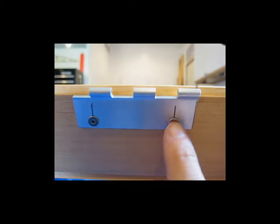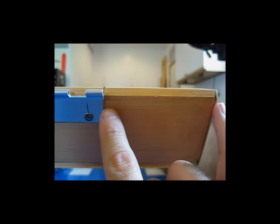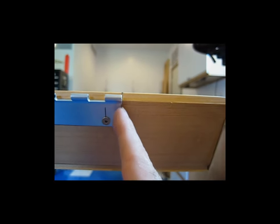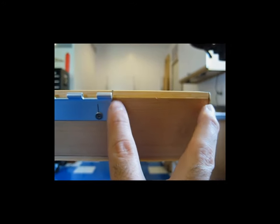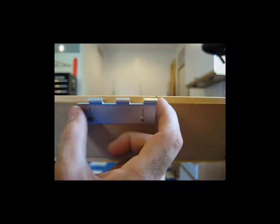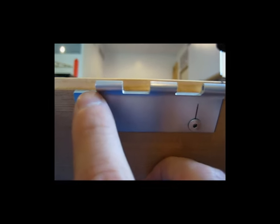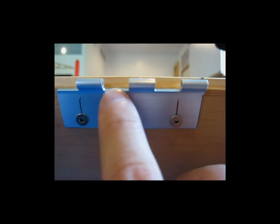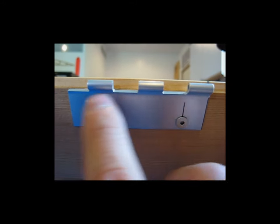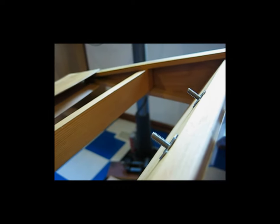Moving down to an end hinge. This is one of the end hinges — same thing: pre-drilled, down low, three-inch. I have it set back from the end of the aileron three inches. That's not critical either — you can have your hinge all the way out at the end or in a little further, but I was comfortable with three inches. Then I lay the hinge on that end, and again I line up the top of the hinge with that line formed between the spar and the filler strip, mark the holes, drill the holes, and temporarily put the T-nuts on the back.